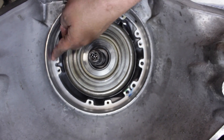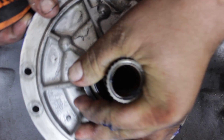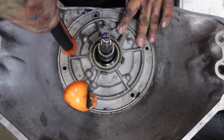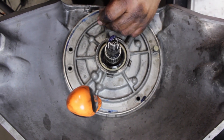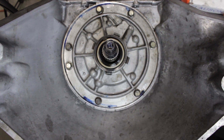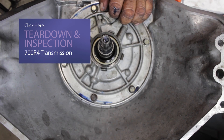Grease up your holes a little bit, hold your gasket in place, and make sure your pump washer is in place. If you do a rebuild kit, there will be new rings for these bolts — these are still soft and in pretty good shape. Torque those to about 35 foot-pounds. Now if you did this right, the input shaft will still turn. If you did it wrong and something is stacked or not seated properly, it's not going to turn, and you should tear it back apart — or you're going to be sorry.